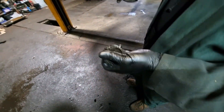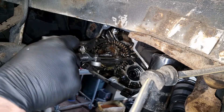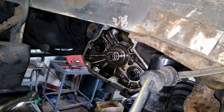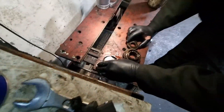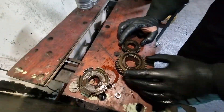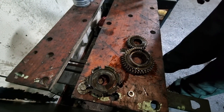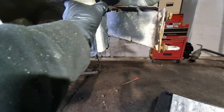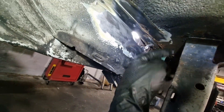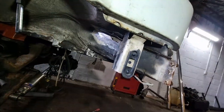Here's the old one. That is your synchro ring. There's your fifth gear bearing - we're gonna just change in for a bigger set. We're gonna let John get a little bit more ready to put it all back in again. My job is I need to lob this little bit off here because this is the bumper support and I don't need it anymore - that way I can get behind there and grind all this lot off a bit better. I've done most of it, will do a bit more to the top, and then Di can come and work his magic. That is my plan now.